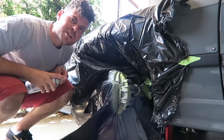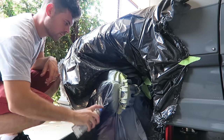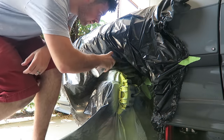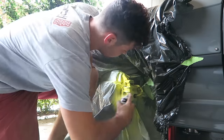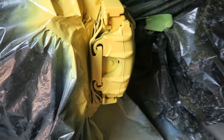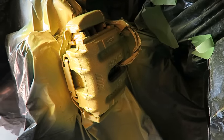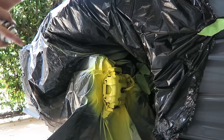That's it for the first coat — this is coat number two. As you start to lay more coats, you can actually lay them thicker and thicker each layer. After the third coat you can see there are still a couple of thin spots, so it looks like we'll probably need five to six coats to cover this caliper completely. This is number five.